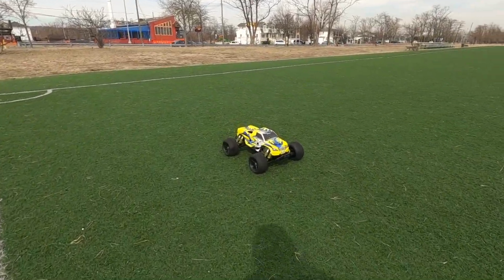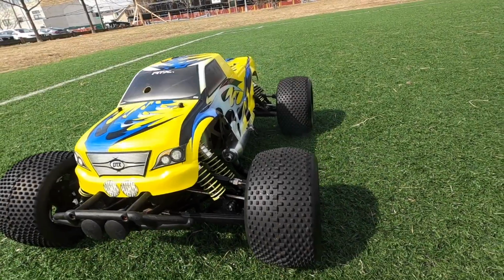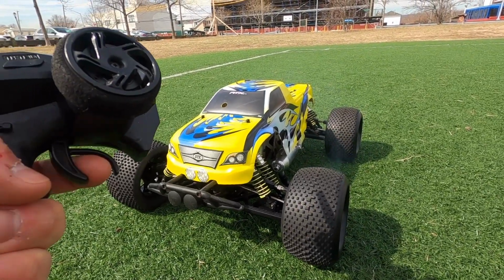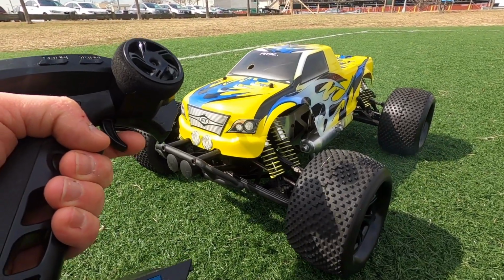Okay, so the idle is a little too low. That means I gotta raise the idle set screw. Adjustments have been made, check this out. No turning off now, look for brakes. Very good idle, doesn't turn off. That's how you want it to run, guys.